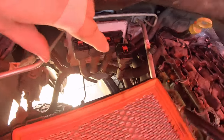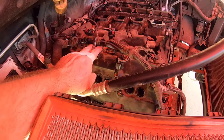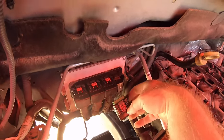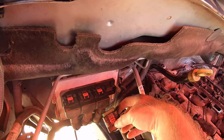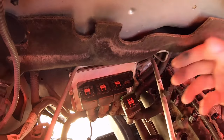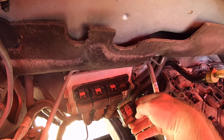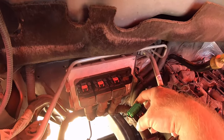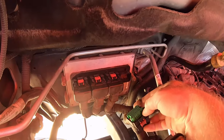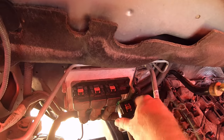We're going to take loose all the connectors off our PCM so we can just roll the harness forward, push it out of the way, and not be fighting around it when pulling the head out. Quick tip: Chrysler likes their red locks. If you can't get the red locks to come undone, just spray them down with a little WD-40 — it won't hurt your electrical connectors and it'll help flush the debris out. A small pocket screwdriver and you should be able to pop those red lock tabs back pretty easily. These connectors are color-coded, so it's easy to get them back in the right spots.